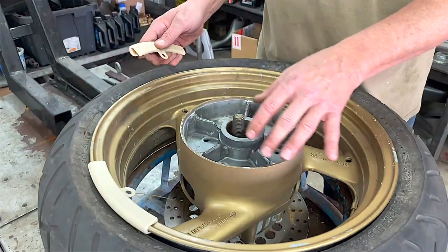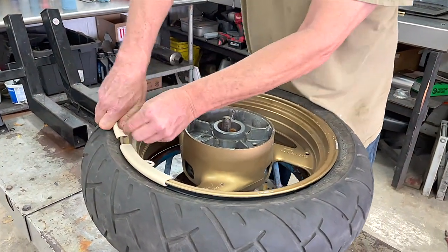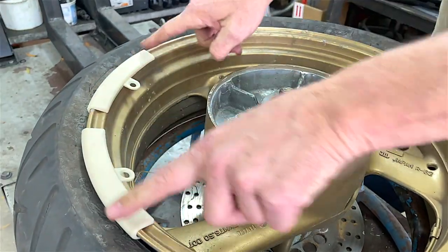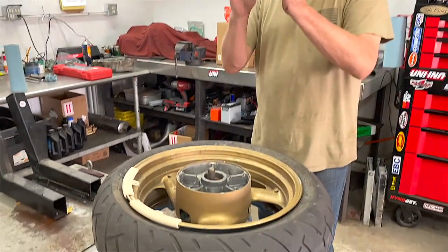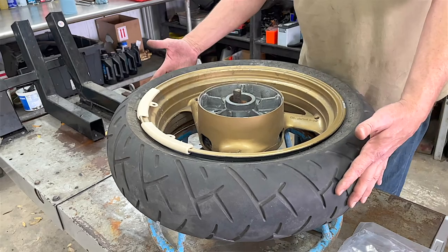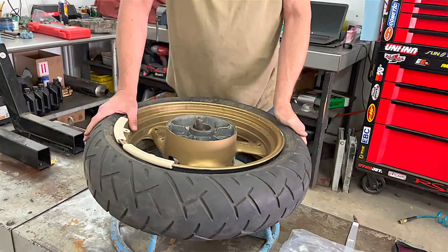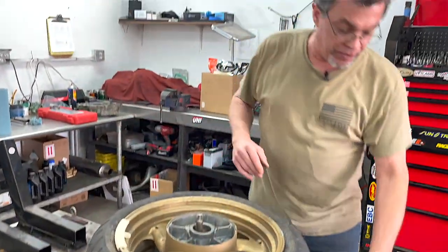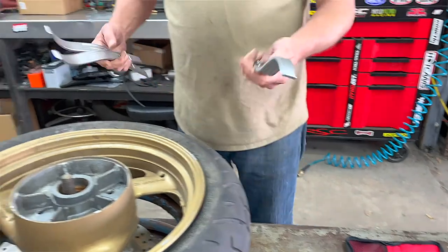The trick to changing one of these tires is not to try and take too big a bite with the tire irons at one time. We want to go a little at a time and just work it around. So we're going to put these fairly close together, and that's going to give us a pretty wide range to operate the tire irons. Also, the inside of a rim is narrower than the outside of the rim, so to successfully get this tire off the rim, we have to make sure that it's down enough to give us the room to get it off. We're going to start with two and have our third in reserve.